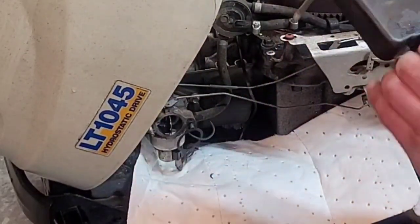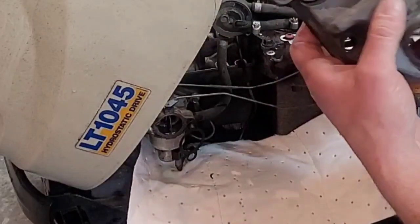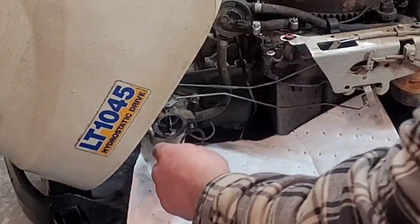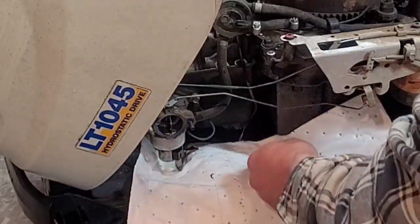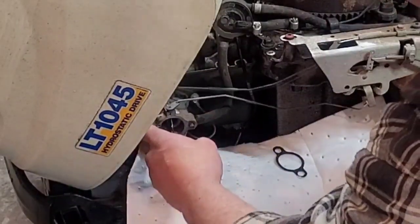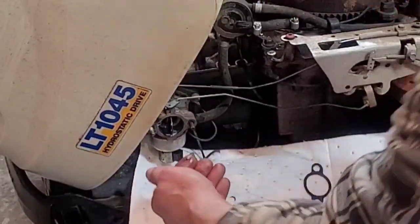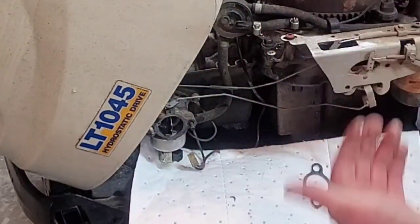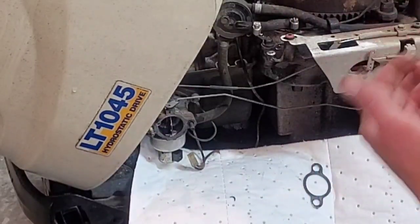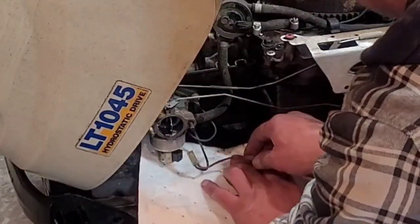There's the air filter housing. You can see on the back that little bracket holds the fuel pump. I've had it off so many times, it's all tweaked. Old gasket. Disconnecting the plug and it's already leaking fuel. That solenoid must be flaked out or going bad, or there's something in the carburetor float — the needle is not closing all the way on the seat. It literally reeks like fuel right now.